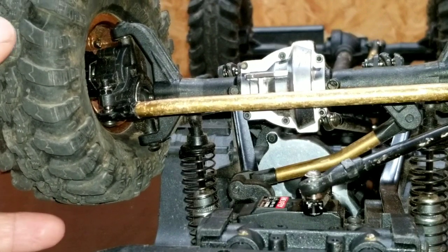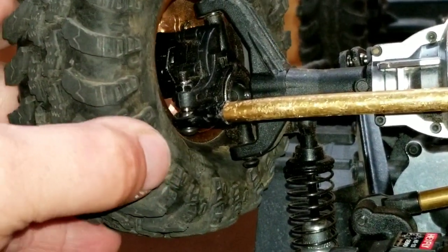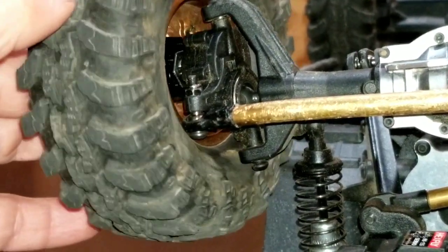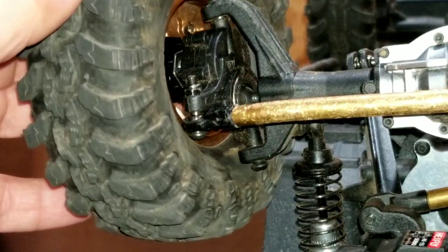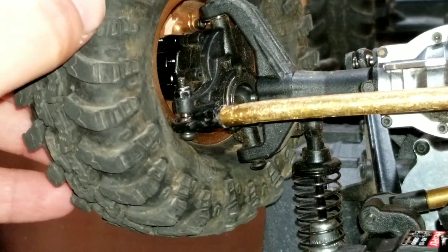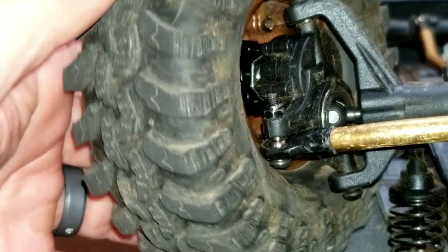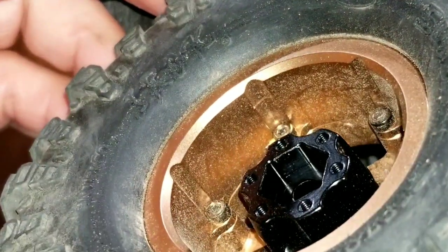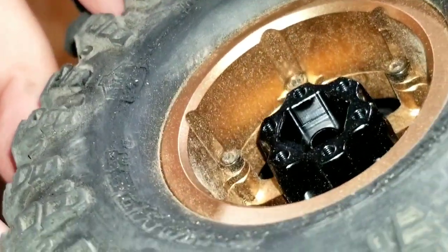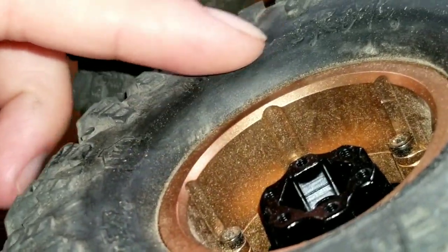Now we've got the truck flipped upside down. Looking inside here — with this wheel and this hub on this side — we are basically all but touching the tire. I probably couldn't even get my fingernail in between it. That's the factory hubs. Now, the factory wheels themselves — if you look at the inside of this tire, you can see it's all chewed up. That is from the factory wheel and hub setup. They rub substantially, and of course that's drag on the motor and electronics. That's resistance — you don't want that.